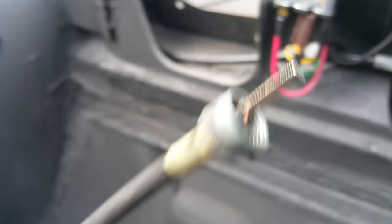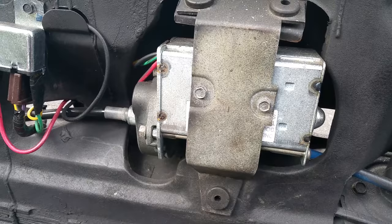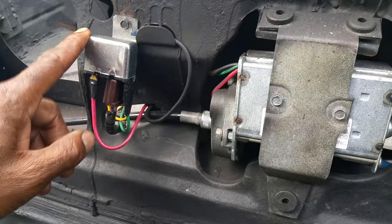I just bought a new set to eliminate a lot of problems. This motor is on eBay — Hydroelectrics has them and Convertible Specialist has them. They run about $225. The transmission runs $225 like I said last time. When you hit the switch it goes through the relay, and the relay tells the motor what to do — up or down. This is the hot wire to your motor, and these are the up and down wires that go to your motor, and this is the main wire from the switch.